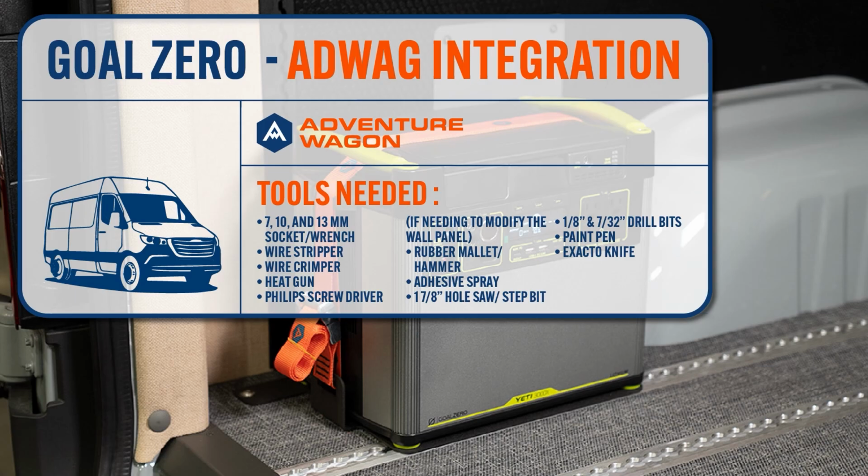So we're going to go over our Goal Zero Adventure Wagon wiring integration kit. This is a kit that's meant to integrate a Goal Zero Yeti system into an Adventure Wagon wiring system. So you can use a Goal Zero Yeti as your house battery, and it can charge off of the van's alternator, just like any other auxiliary battery system.